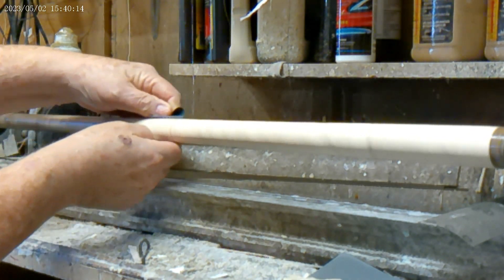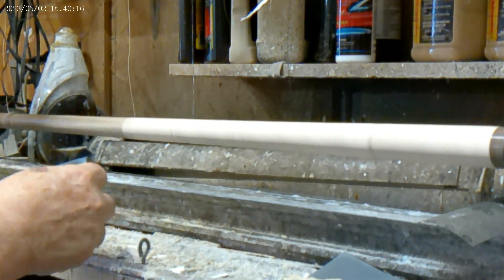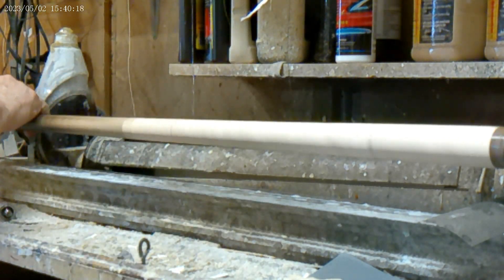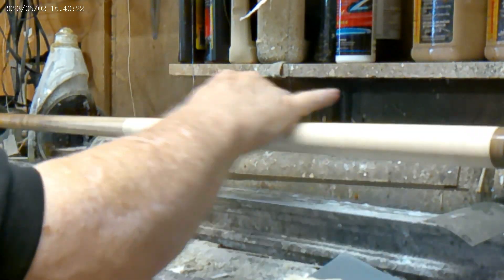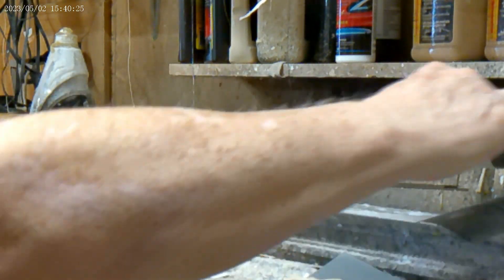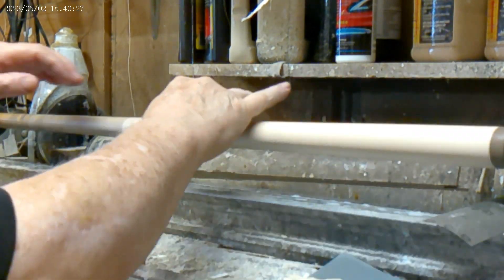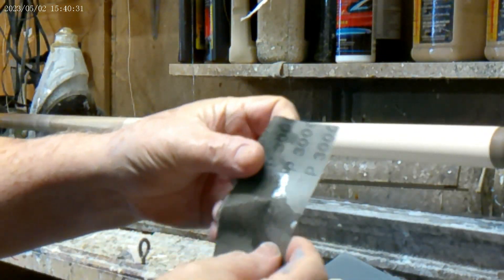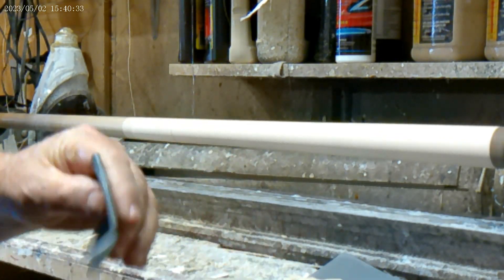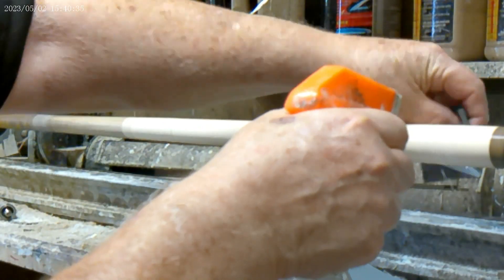What I've got to do is use 1500 enough to take down those 1200 scratches — that's why I'm doing it the way I'm doing it. I'm cutting the 1200 scratches out of it. You can use buffing compounds to do it; they've got buffing compounds that will cut the 1200 scratches, but I can use the paper and it's twice as fast.